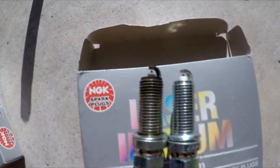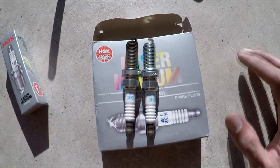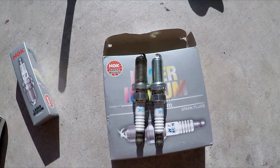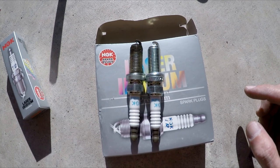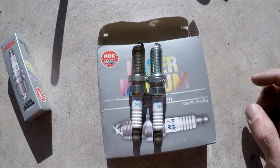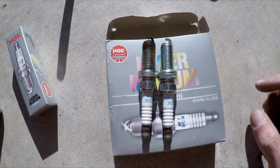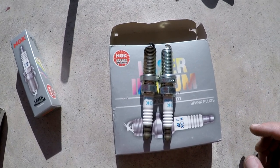This here is actually cylinder 1 — still looks pretty good, maybe a hair darker than the others. One thing I forgot to mention: when you do put these in, you don't need to put any grease. If you do, put barely just a little bit on it. The NGK plugs are made to go straight in without needing any special grease on the threads. They go in pretty straight and really easy. I haven't had any issue taking them out or putting them back in.